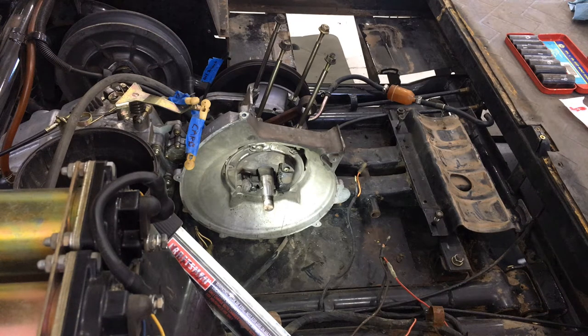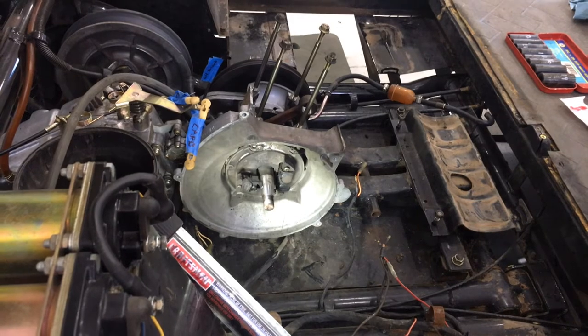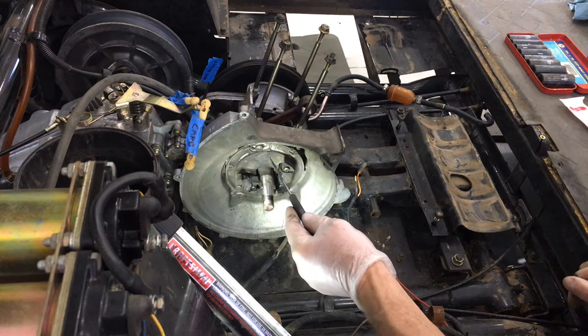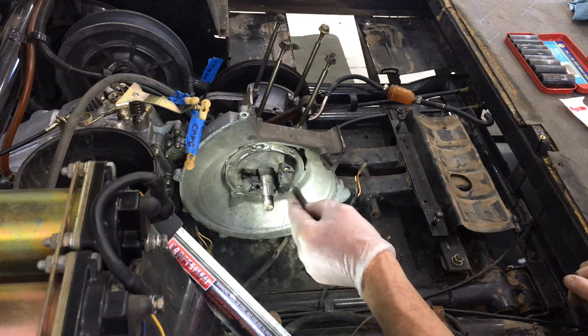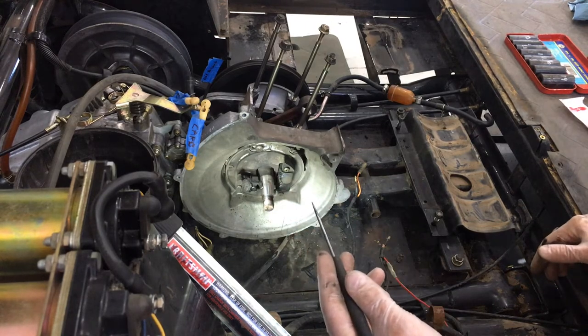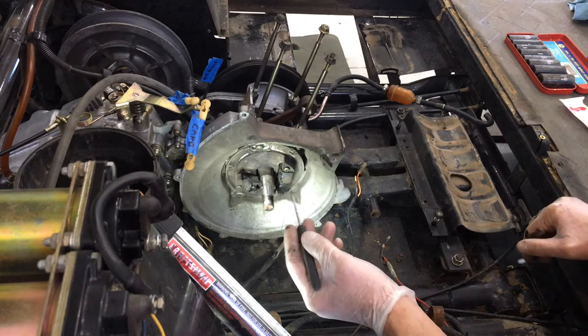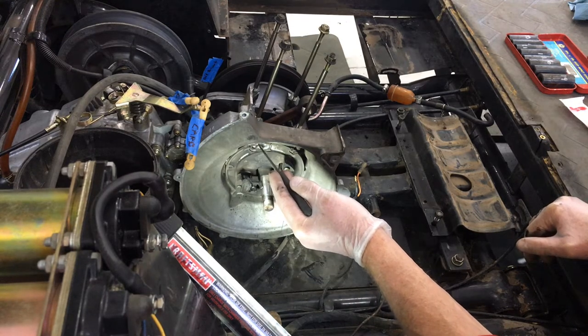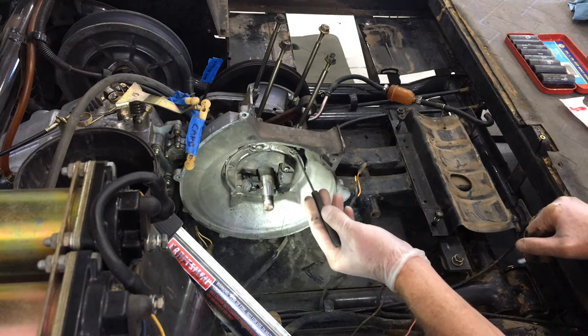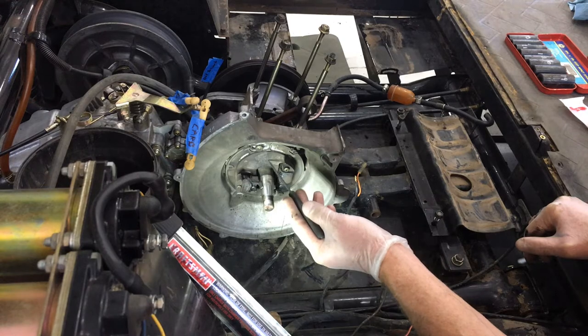We got the flywheel off with relative ease. The back setup was caked with dry gravel dust, but we're getting ready to take off what I think is called the stator - basically the plate with the coils. One thing I want to reiterate, based on what I've seen on YouTube and other videos, is that you need to scribe around your screw marks to indicate the position of this plate.